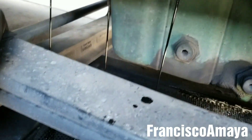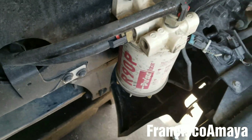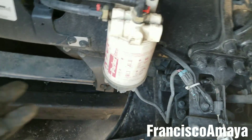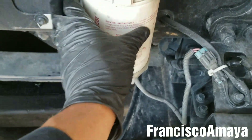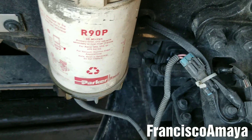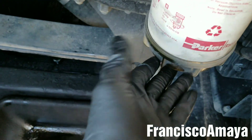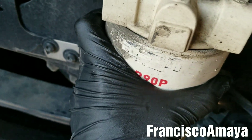In the meantime, what we can do is replace the fuel water separator. In this case, the fuel water separator is right here, so we have to grab something to collect the fuel as it drains from this filter. The first thing we have to do is disconnect this plug over here — this is for the water sensor — and then we can remove the filter. It is tight, but it's rotating.